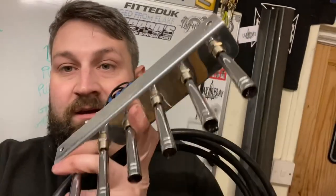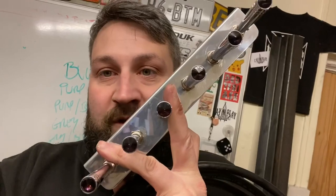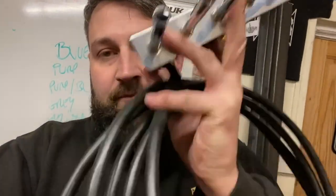So that concludes the basic switch wiring of a 2-pump, 4-dump, six switch panel. We will show you in the next video how to install the panel, run the wire underneath the seats, carpet, etc. into the back of the car, wire that to a terminal block in the trunk, and then wire from the terminal block to the pumps and batteries. And we'll also show you how to do the battery wiring, and then that will be that first lick of the switch. Thank you.